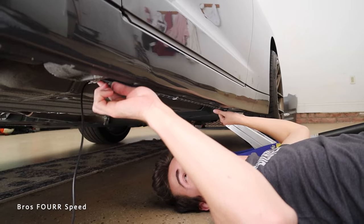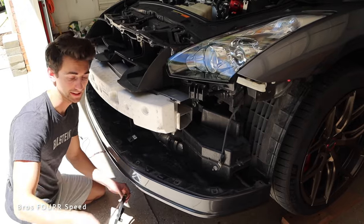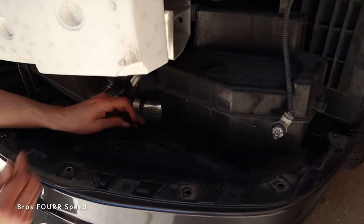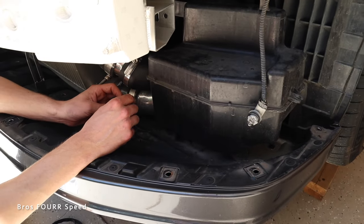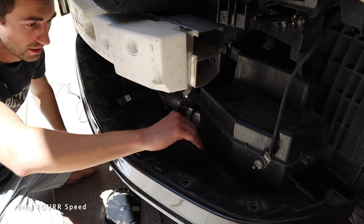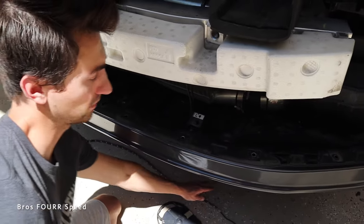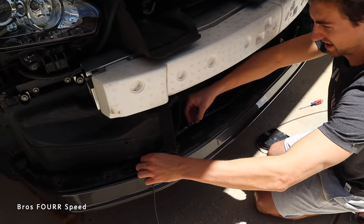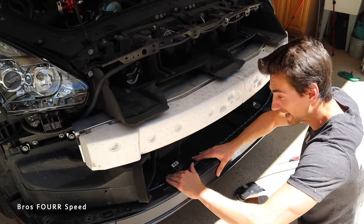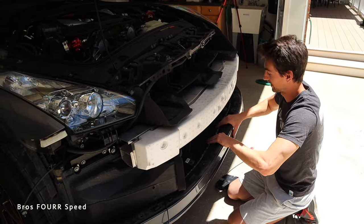To feed the wires I use a metal snake. We fed it under the intercooler and got the cable through perfectly — right length, running through the underside of the control arm with a nice straight shot and nothing interfering. The whole plastic area has been cleaned with grease remover. The key goal is to keep the actual light source hidden: when you can see the LEDs themselves it looks cheap, so keeping them tucked makes all the difference.